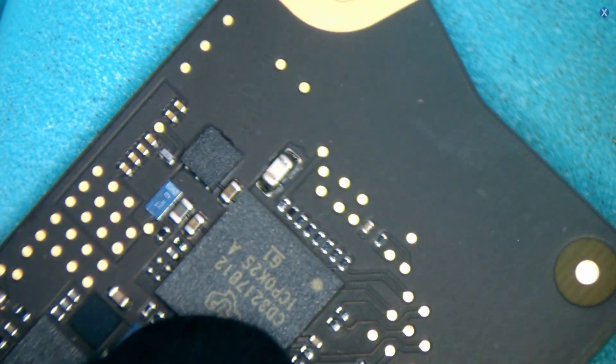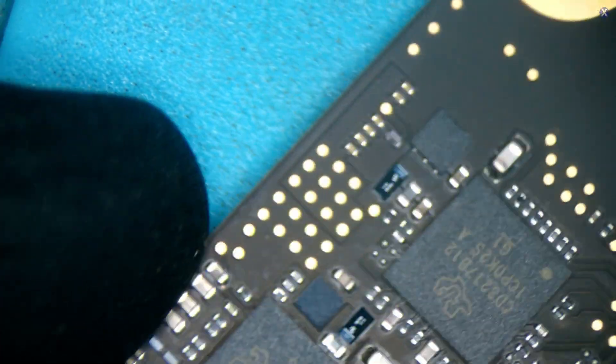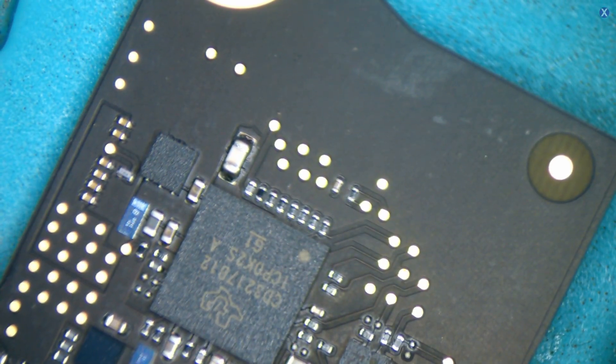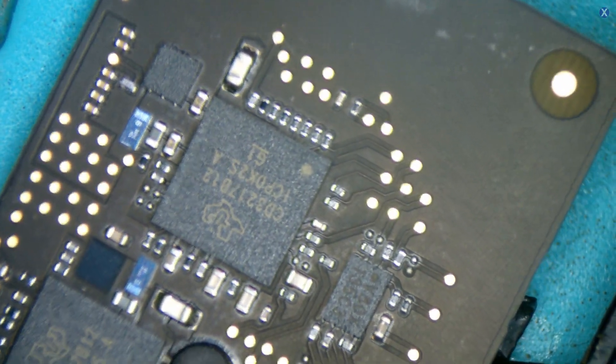These are your CD3217B12s. There will be a few of them — two up here and one down here. There's a MagSafe up here, a USB-C here, and another third USB-C down here. These are all your charging ports — two USB-Cs and a MagSafe. In a technical sense, all these connectors are the same — they're a USB-C charging circuit. Even the MagSafe is. It's not a direct charging line; they just made the USB-C into a MagSafe. That's all it is.